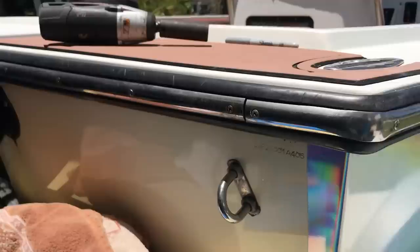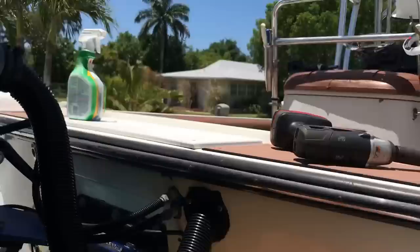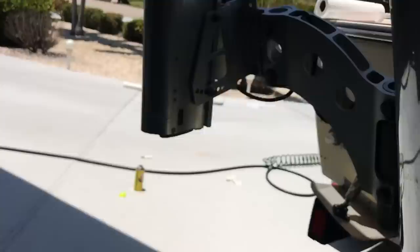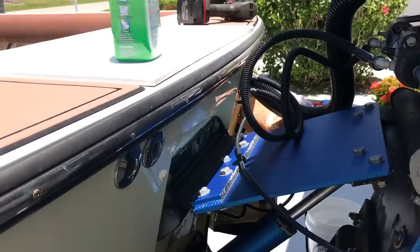All right, so Tommy just finished out the edge of the wrap on the corner. And for those of you wanting to know how come you don't wrap the back of the boat and the transom, tell them why, Tommy. You just don't do it, it costs too much. Yeah, because look and see, you've got a jack plate, you've got all these fittings, you've got all this stuff. Can't get around it all. It'll look like a butcher job. Yep, all this stuff that's in the way. If you try to wrap it, you have to take all that stuff off, which is impossible because it's put in with 5200 and all kinds of sealants and stuff.